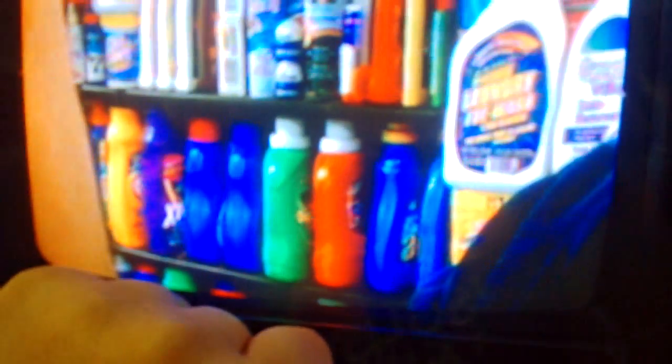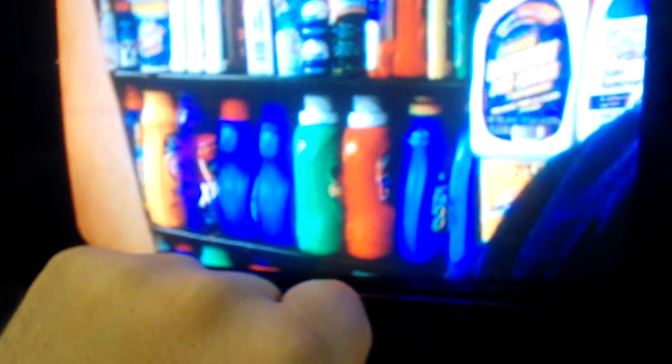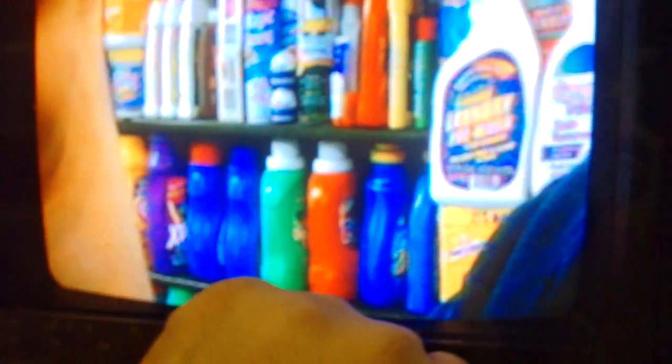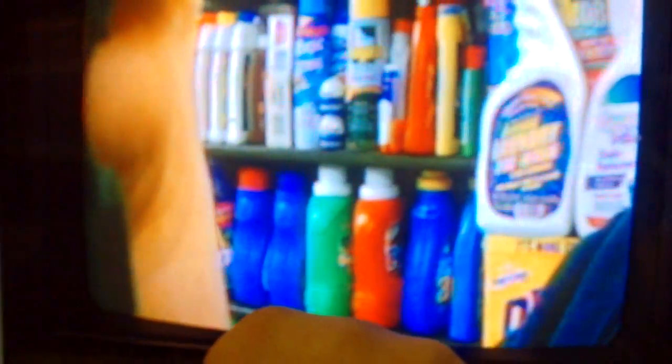The camera makes the color appear a little more vibrant than it actually is. There we go — that'll come up. Real nice color. You can go all the way down to practically black and white, or all the way to overdriven — so right about there is a nice balance. The tint, I think, is perfect. The controls are a little dirty and it makes the screen bounce. There's a center detent position on the black level control. Maybe there's not enough voltage for it — oh, I'm still on 12 volts here, we'll play with that soon. The picture control seems to be all the way up, but it's not even that bad at the mid position.